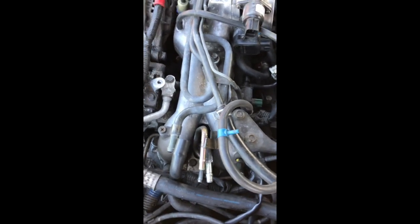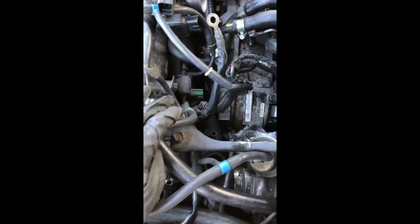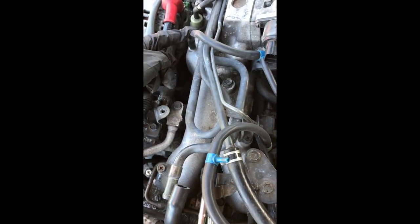And next I'm going to disconnect this pipe here. As you're no doubt aware by now, it's a bit of a myriad of vacuum pipes on the BH5 twin turbo, slightly more if you have the auto version. So I've just been looking at the best way to disconnect this little plethora of pipes here, and I think because this solenoid is attached to the inlet manifold and this pipe here is attached to the inlet manifold, then the easiest thing to do is going to be to remove it from this further connecting T-piece, which then goes to various places, including pipe 10.